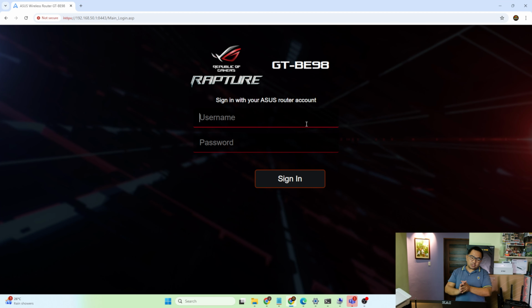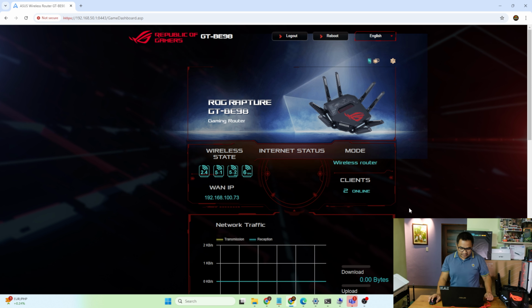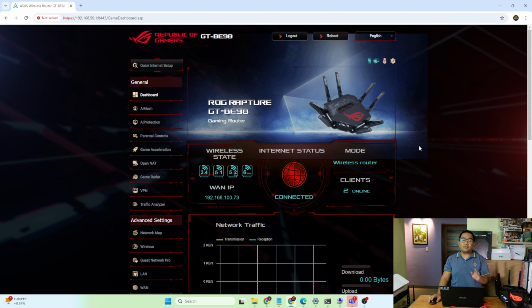Okay, guys, for the web management console, you need to log into the default IP address of the router. For us, it is 192.168.50.1 and then enter. Okay, guys, now let us check the things that we can actually do on the web management console. I won't be discussing each and every one in detail because it will be a long video. But for us, let's access it right now. The default IP address for our web management console is 192.168.50.1. And let's enter the credentials that we have set earlier. Okay, enter. And okay, right now, we are on the main web management console.